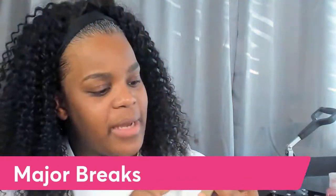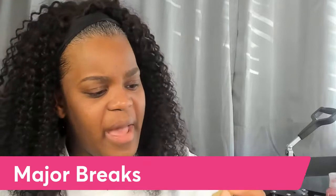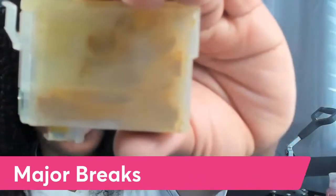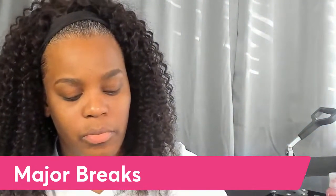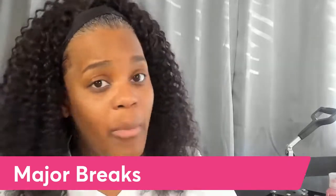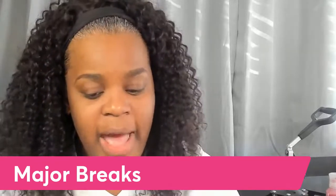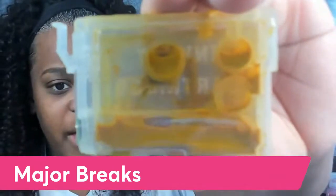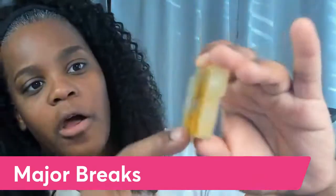The way that this is set up, there is this little circle in the middle that must be filled with ink. Right now, okay, it could have a little bit more. But if that is ever empty or full of a really big air pocket, it's not going to print out properly no matter how many print head cleanings you do. That's why you want to do your nozzle check to check the state first, and you'll know which cartridge to test.